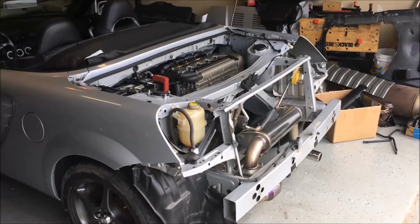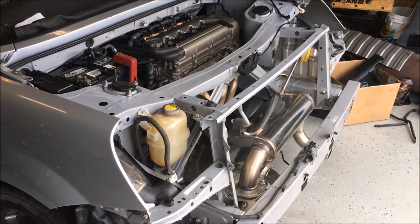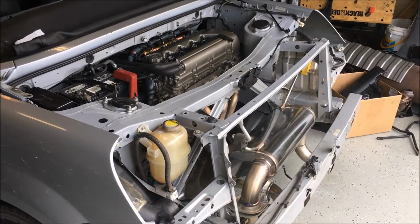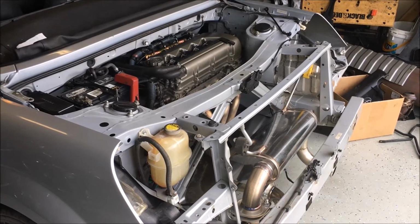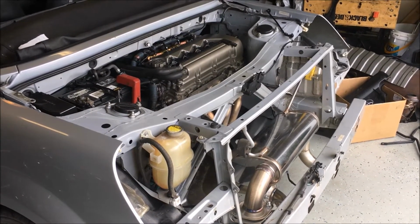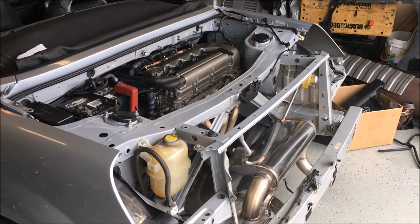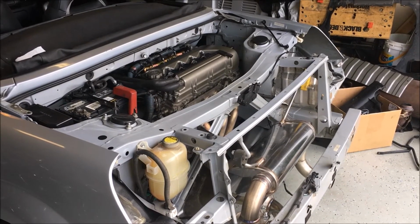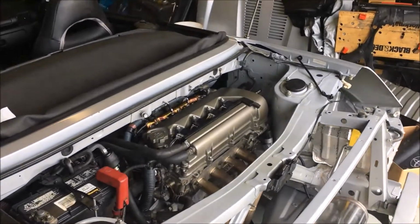All right, so the engine's up to temperature, and now this is what happens to the idle. It just bogs itself down. I'll put the graph in so you can see what it's doing. It's very consistent. So my initial thought is that it's the idle air control valve, but I'd love to get some input from everybody if they have any ideas. Also, I still have to figure out what happened in that first cylinder.